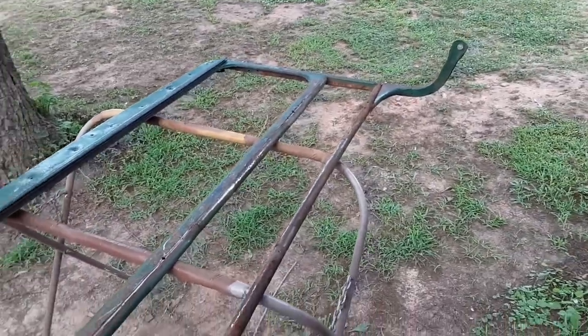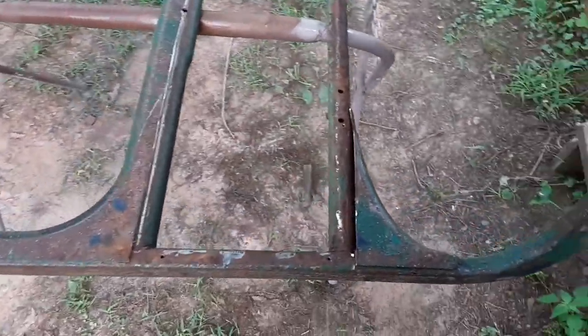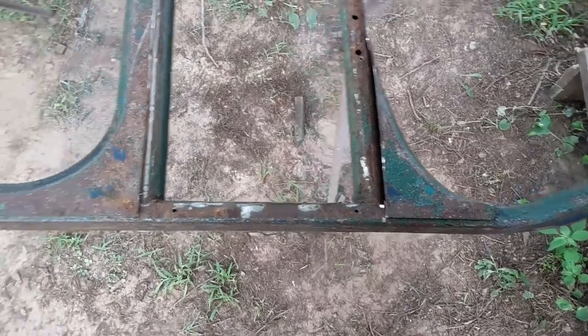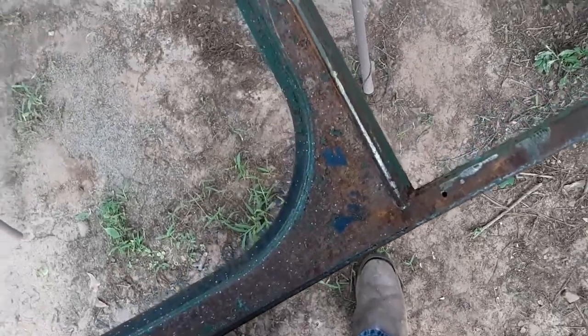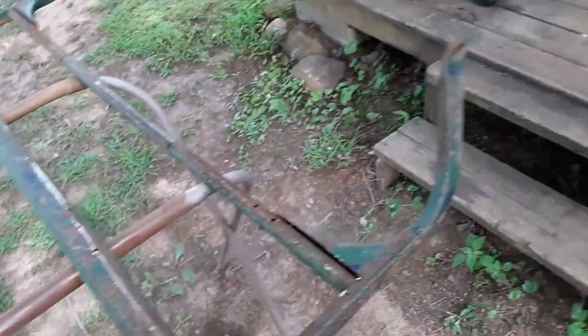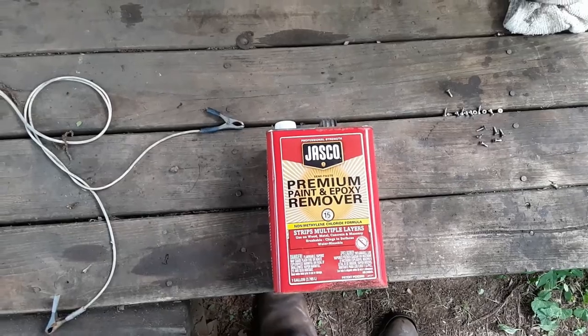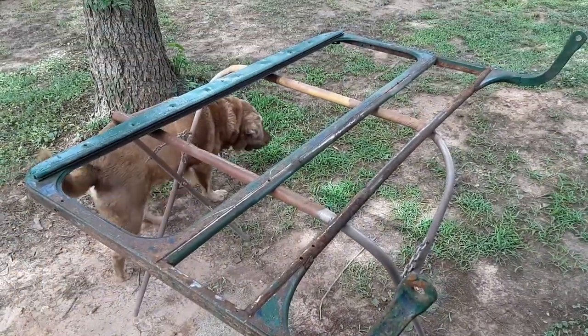Alright, I'm back out here on this windshield frame — it's the next day. I'm going to try to start getting some of this paint off up here. There's not a lot on it; it's pretty much bare metal. But where there is paint it's going to be hard to get. So I swung by Lowe's today getting off work and I grabbed a gallon of stripper. I'm going to see how good it does — just going to put it on with a paint brush. I've used stripper before on this Jeep to get some of this paint off.